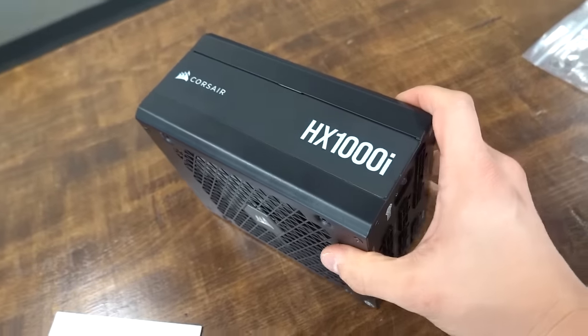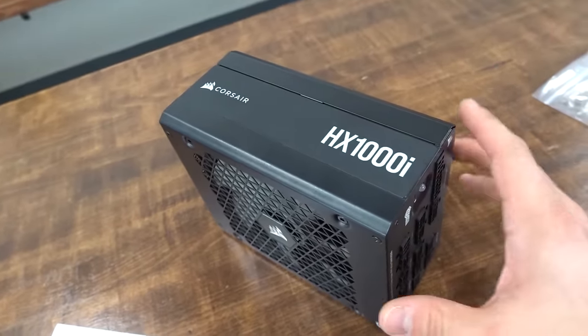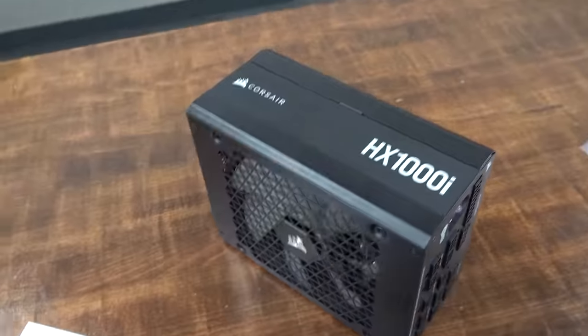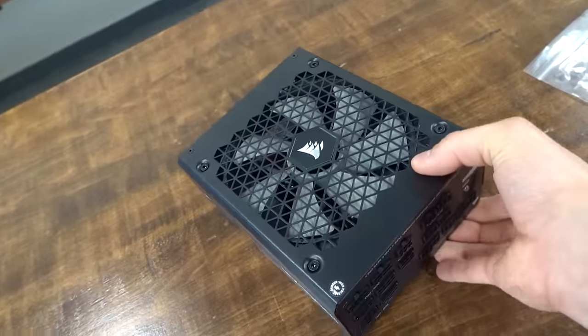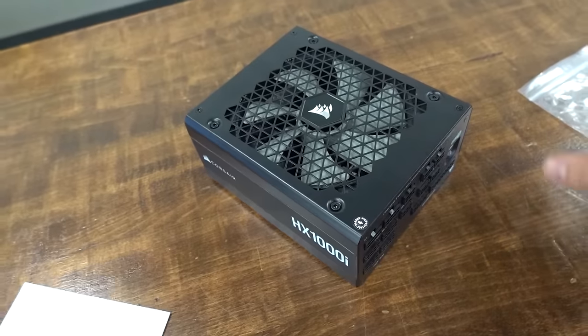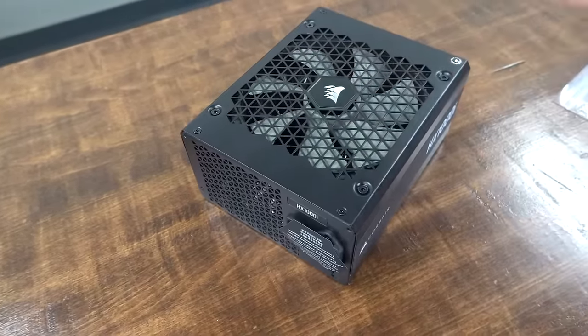In case you don't know, a test boot is where you simply test out the core components of your system before you've built the entire PC, just to find out that something doesn't work or it's not posting for some reason, and then you gotta disassemble the whole thing. So usually I'll just test boot the CPU, motherboard, GPU, and the RAM. Those four core components that aren't installed in the case yet, you haven't wired up all the RGB, just in case something goes wrong, it's less of a pain in the ass to fix.